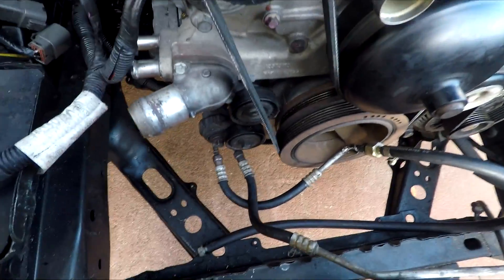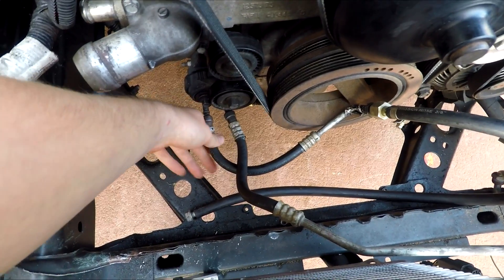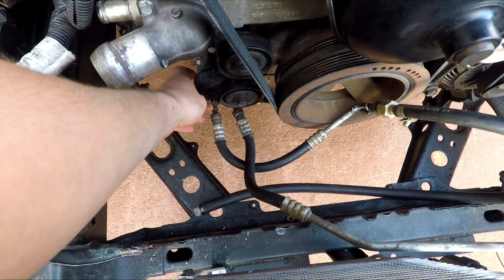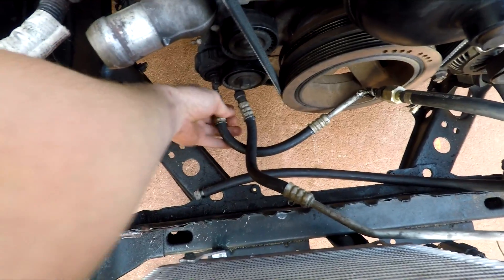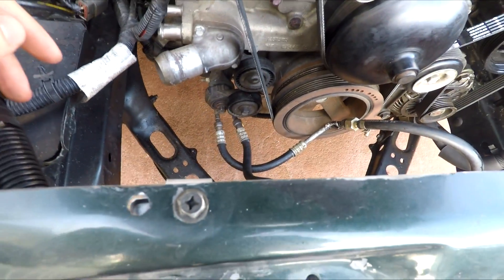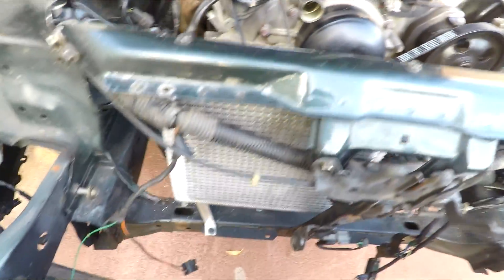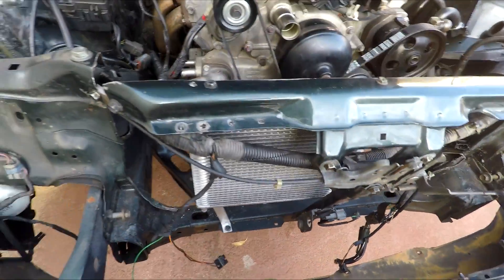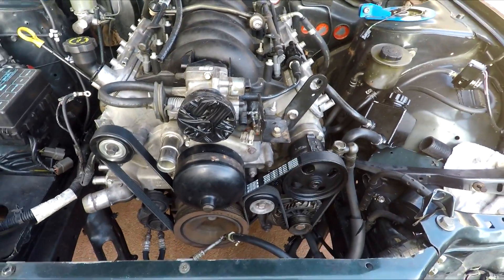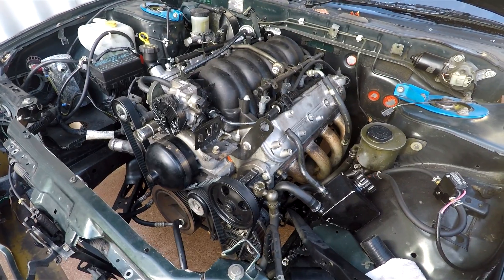Next on the list is the power steering lines. On the standard LS they have these quick connectors - I got fuel line ones but they're too small. People have talked about cutting off a bit of sheet metal and shoving it in there, but I'm just going to grind them off and put normal transmission line over it with a hose clamp. Once that's sorted and I run my trans lines up to the cooler and do the power steering lines, I'll chuck the radiator in, put the hoses on, and then we can start doing things like the wiring and the shifter.